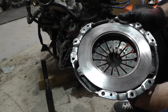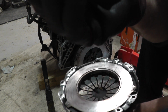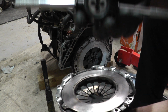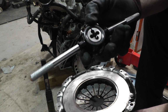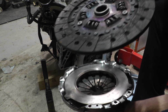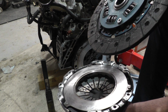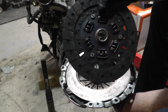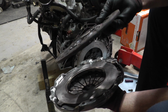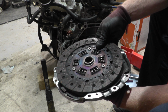Right, after the clean-up process, I'm ready to fit the clutch. I've cleaned all these bolts up by just pulling them through the die. So this is the die I've been using. It's M8 by 1.25, which is the thread of the bolts. Clutch disc going on. Obviously it hasn't had a lot of wear, which corresponds to the kind of markings on the inner, so interesting, but this is the way it goes in. So the raised side goes in to the base there.